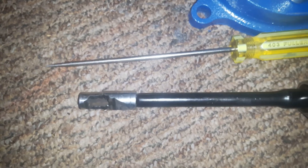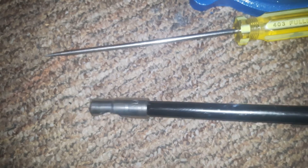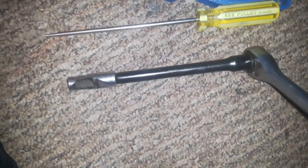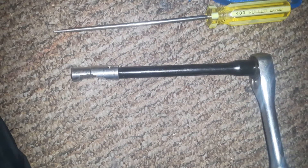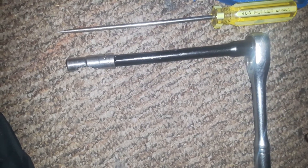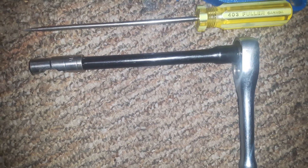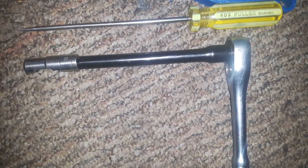So this is the homemade valve lash adjustment tool — 10 millimeter. Note: the inside is hex, not a multi-rib socket. I find this easier and better for holding the bolt down. This homemade valve lash adjustment tool saves thirty to fifty dollars. Hope this helps — please share and subscribe and check the description of the video. Thank you.